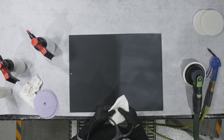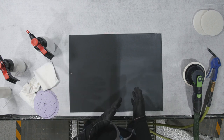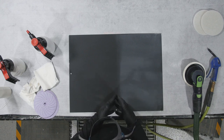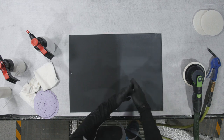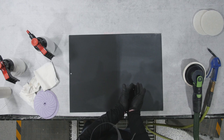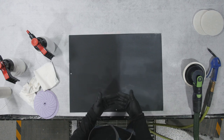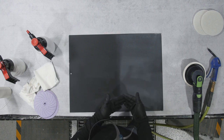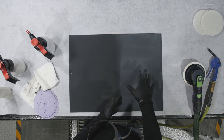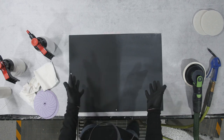We recommend clean, fresh paper towels folded so that we can flip to fresh sides. One important tip is to wipe until completely dry, flipping the paper towel to a fresh side to effectively remove contaminants and avoid the cloudy residual film that can form on the surface. As you can see, on one side I wiped until completely dry, and on the other side I did not. Failing to wipe completely dry could lead to paint defects like fish eyes, because we're not getting all the contaminants off the surface. Further, the cloudy film could even be visible underneath a clear coat on darker colors in your blend areas — so blow off and tack as necessary.